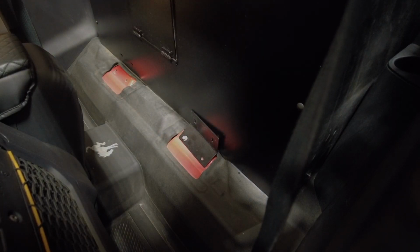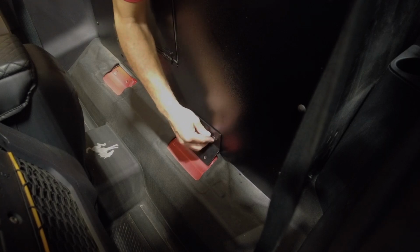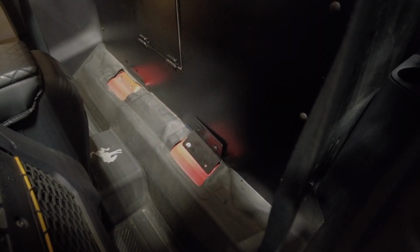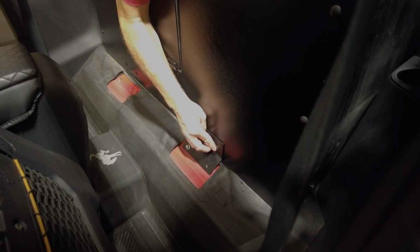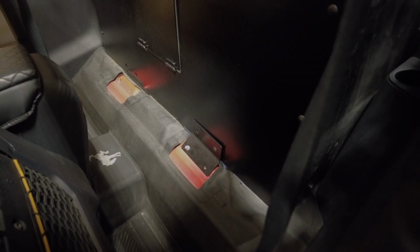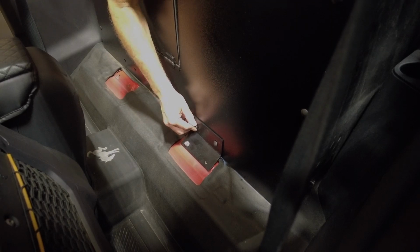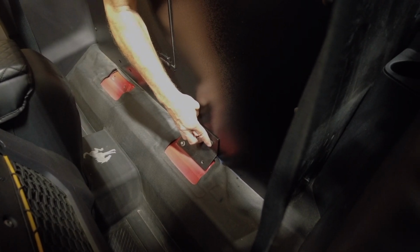so it holds it. And I'm going to take two carriage bolts, and I'm going to pop them through my wall. We made it so this is slotted vertically and horizontally on the wall. So it's vertical on the bracket, so it allows you to move this a little bit. So as long as that doesn't fall out, as I'm grabbing this, push that back in. And again, I'm going to tighten these up to only about 90% so that I can still adjust this left to right after we put the tops on, so everything's nice and square. We want everything to be a nice, easy fit. So let me tighten these guys up on the back side, and then I'll move to the other side.